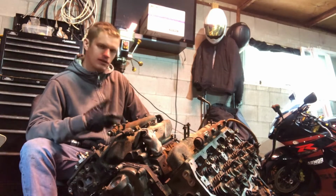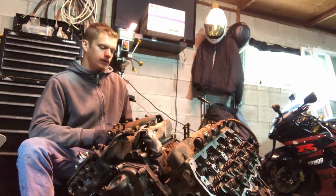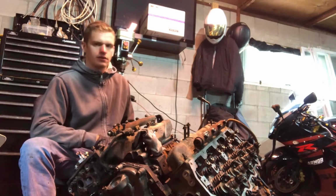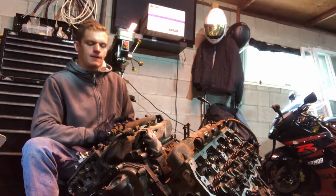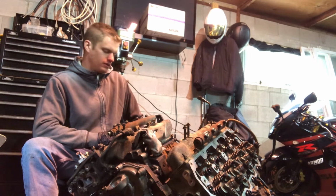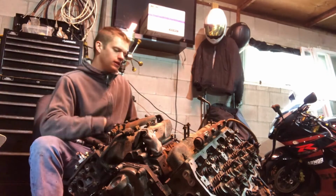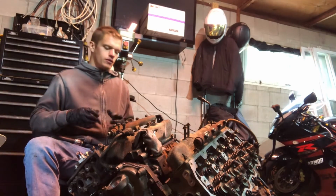For the LB7, it's got a different turbo. It's a bit smaller turbo, and the way the top end of the engine works is slightly different. The bottom end of the engine is pretty much the exact same, all the engine blocks, what's going on down there, other than some differences in the internal parts. So some upgrades you want to have done on an LB7 is a turbo intake horn, a larger one than the stock one. That'll allow much more air to get into the turbo at a higher rate of speed, especially since it's a smaller turbo.